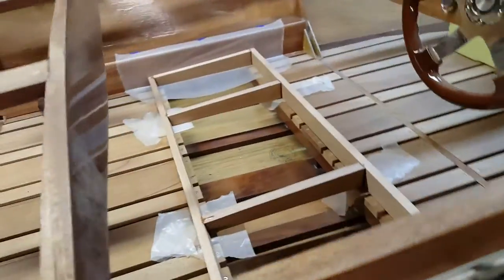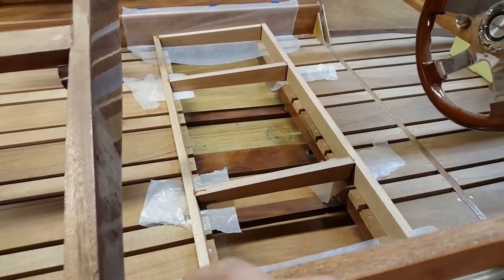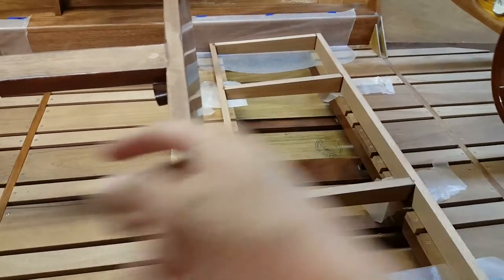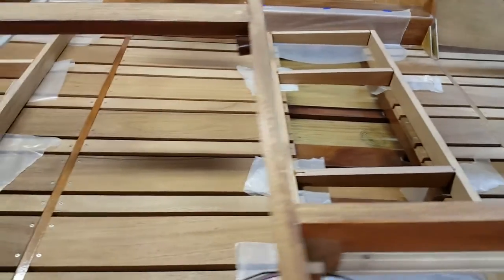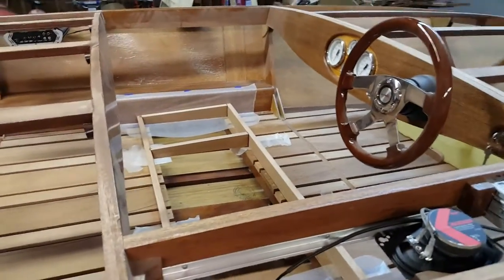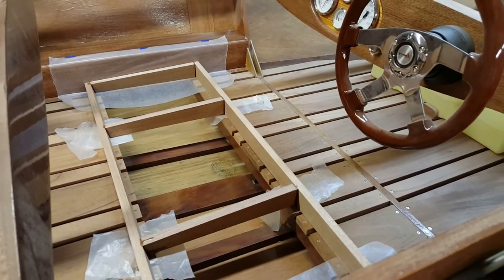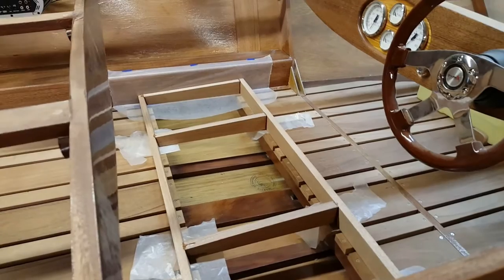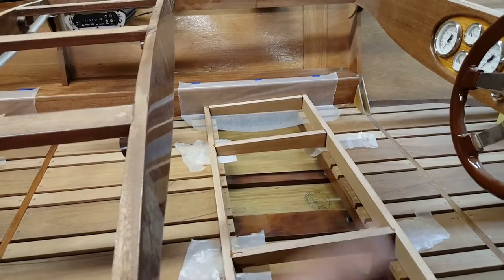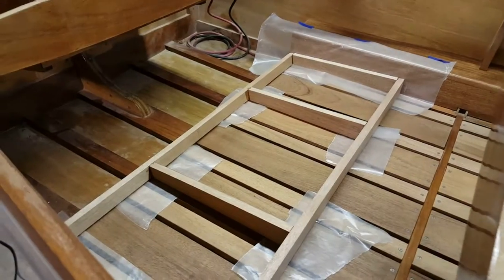That's the important part. If I ever need to take floor planks out, you know, who knows, drop my keys in there, I don't know. I need to be able to remove the seat base and a couple of floorboards so I can get in there and get stuff out if I need to. Or if I need to make repairs, this needs to be removable. So there's an incredibly long-winded description of the seat bases, why I made them that way, how I made them that way. Again, they're all assembled with the 16-gauge brad nails, and after they cure up, I'll put little tiny amounts of Famowood in each hole to plug them up, sand them down, and continue on, but making fantastic progress.